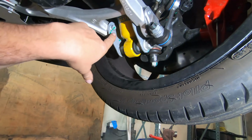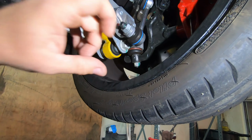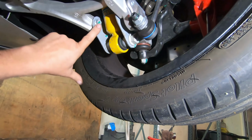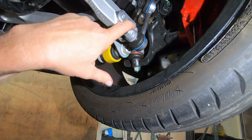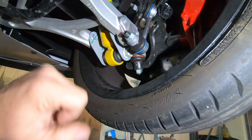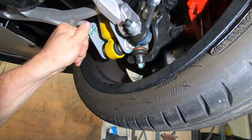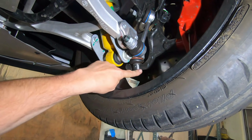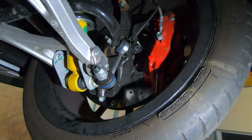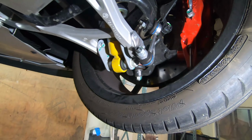This is a fun little detail. All these little green marks here, little green pen marks, those are quality control points for the people who are building the car. One person's coming through and he's gonna get all these and tighten them, and when he tightens them up to the specifications for the manufacturer, he puts a little green mark on it, so the person who comes behind him to check his work can just visually go, okay, somebody torqued that, somebody torqued that, somebody torqued that, and that's how they know. See, even in there and up here, you can see a quick visual check. Hey, everything got torqued. It's going to be a safe car to drive along.